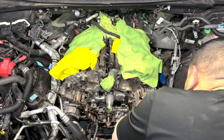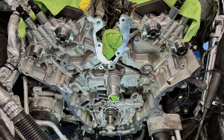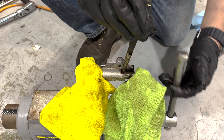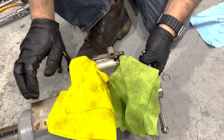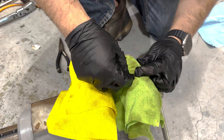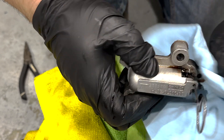The block and head surfaces took me about two hours to clean, being careful not to let anything fall into the oil pan or any other passages. If I wasn't replacing the tensioners, I'd also need to prep them for installation using a vise, needle nose pliers, and a bit of thick wire or a finishing nail — compressing the plunger, squeezing the locking ring until the plunger's shoulder passes the hole, then throwing the wire in to lock it into place.